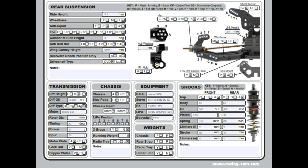To remove even more of that quick reaction, I'm hoping to either add a stiffer roll bar - I already put one in on the day to try and reduce steering - or I'm also going to try adding a bit of toe-in and play with the Ackermann, to get the same steering input but smoother and more stable. That's about it for the changes I made on the day - there might be some other stuff, and you can always check the setup sheet on screen right now.